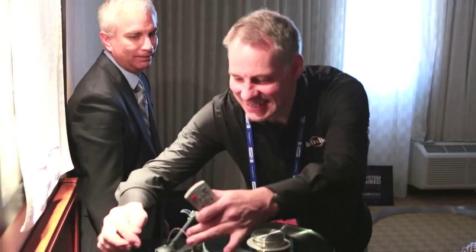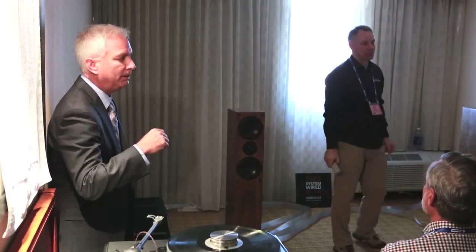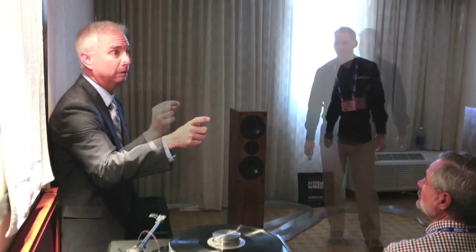Once you get down to the short strokes, you're going to be going over to your counterweight and just touching it. We don't really care what the final number results in. What we care about is the result, because it's going to be different for every cartridge. So these three cartridges all have different ultimate settings. What I would want you to do, though, is at the end of your exercise, make sure you're not wildly out of the manufacturer's window. You're applying damping, and you don't want to put too much damping or too little damping for what that cartridge was designed for.